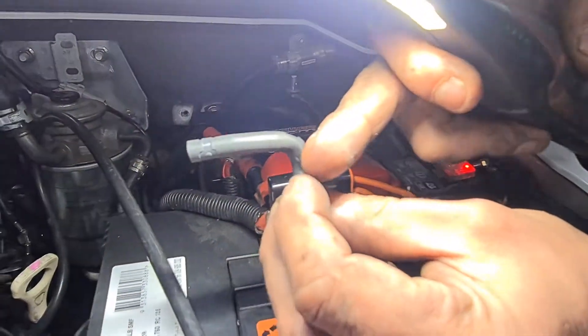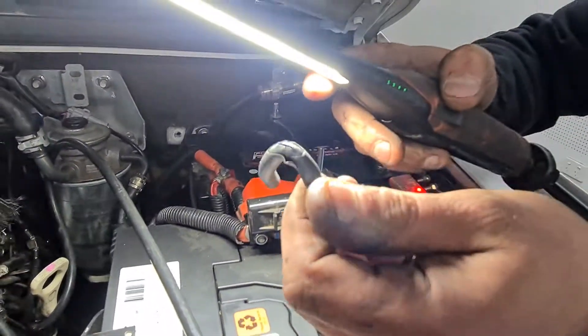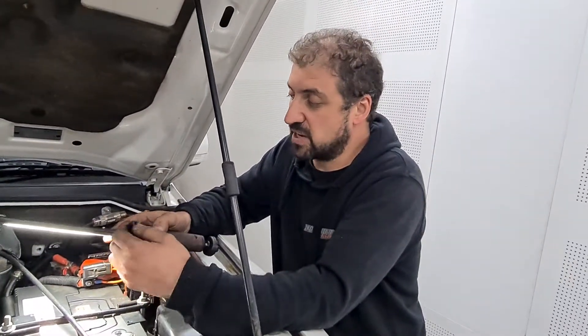As you can see, there's a little split right through there, so this has been leaking for quite some time. It's actually blown out what looks like a little bit of heat shrink around the end of it — that's been blown out over time. So this has probably been leaking for well over a year or two. We replaced the line, boost is back up, and we've completed the tune.